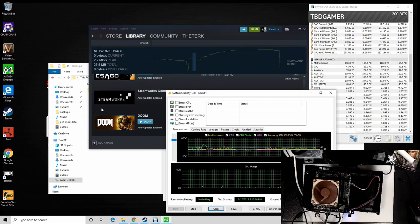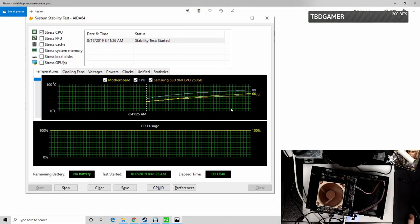We've been doing a little bit of research and prep before the stream tonight, and we've actually got a little bit of data to talk about. This is a picture of us running AIDA64's stress CPU workload while the lid was on the machine. As we turn the workload on, this system just gets hotter and hotter and hotter. Following that slope up, it never truly flatlines, which indicates to me that we've already met our thermal threshold for the system, and we gotta have a way to bleed off air, obviously.